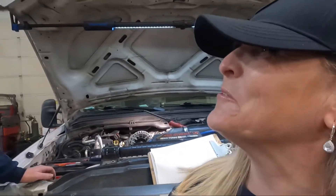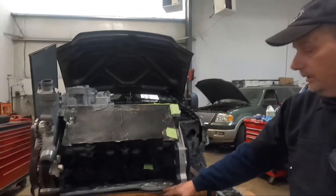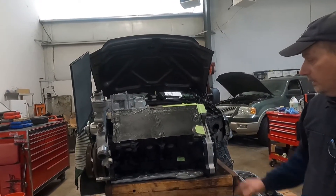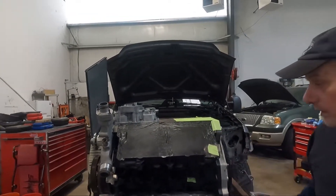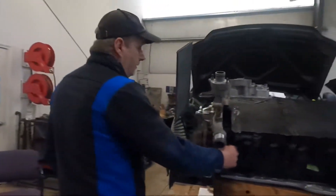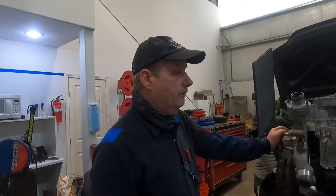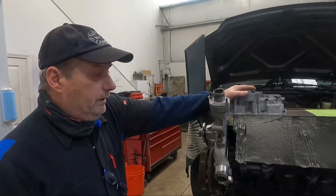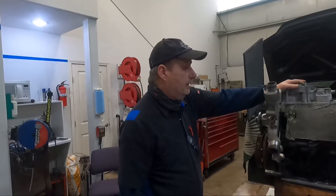So how about that 2004 that we were talking about — how far have you got on it? Got everything cleaned up. I replaced the upper and lower pan gaskets, the bed plate seals on both sides, front and rear cover gaskets, front and rear seals — all of which were leaking. New O-rings on the cam and crank sensor, put a new water pump in it, and I'm waiting on the cylinder heads so we can put them back in. We also put a new oil cooler in it.